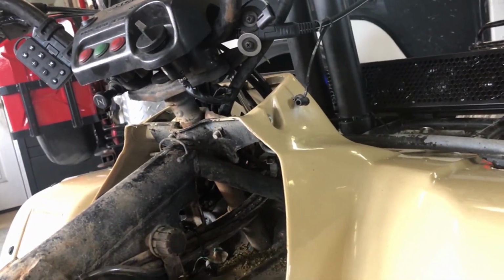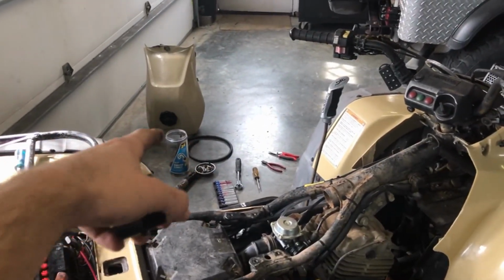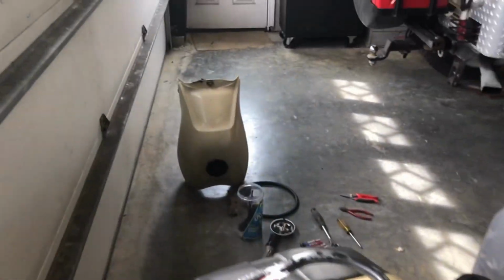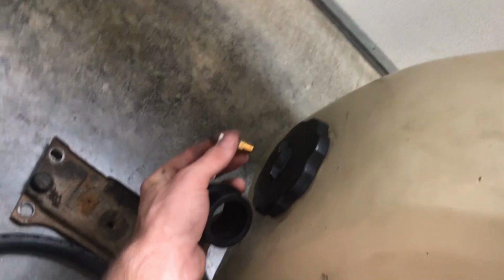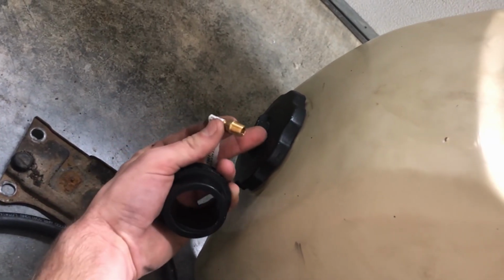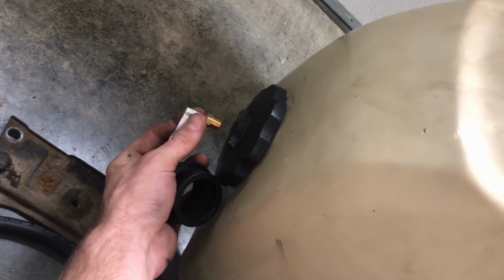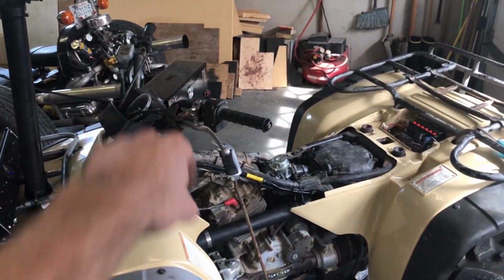And that's about it. So as far as the gas tank, what you do is you pop off the vent. And they got a video on YouTube. I've seen it on there before, so I'm not really going to show you how to do it, for the video's already on there. You just pop this off, put the vent on, pop this off, JB Weld this in there without blocking the airway, and then you have a vent going to it.